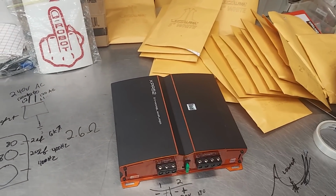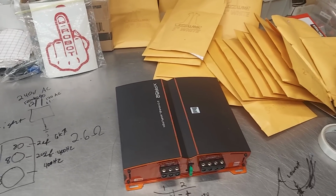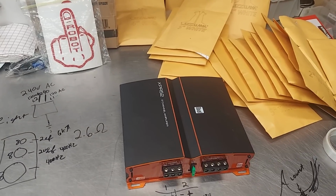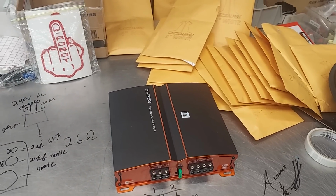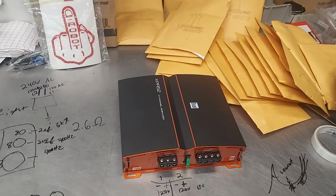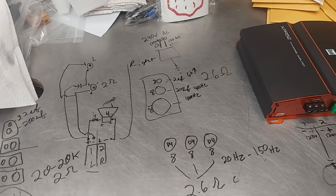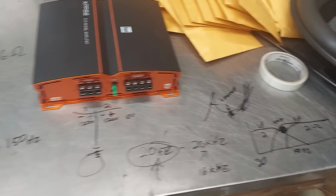Think about that. You also chop your damping in half, if anybody's worried about damping characteristics, every time you drop your impedance. What do you know? So maybe you shouldn't use that 8K at 1 ohm. Maybe you can use it at 2 ohm, 3 ohm, 4 ohm, and there's still plenty of voltage and lots of control. Go figure. You're like, no, I paid my good money, I want maximum volume, maximum bass. So anyways, that's try mode for you.